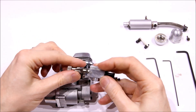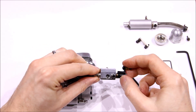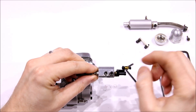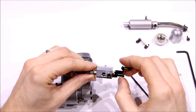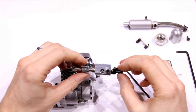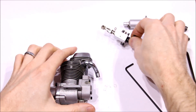These airbleed carbs have an interesting feature — they have a pull-out choke. You just pull on the throttle barrel and it slips out. That unseats the needle seat from the needle and opens up the fuel flow. You just flip it over a few times and it will prime the engine without having to reach in to choke it. When you're ready to start, just push it back in and it's ready to go.